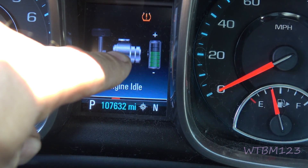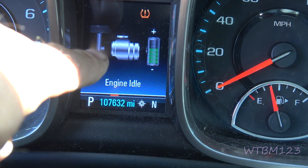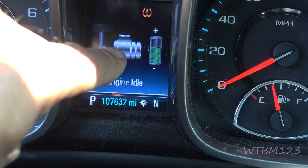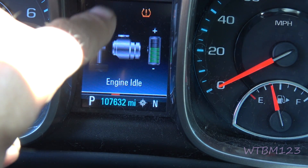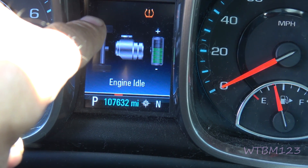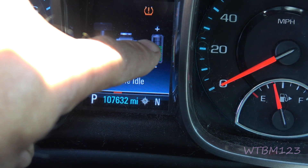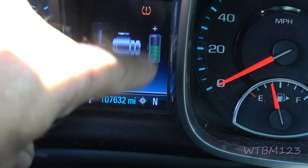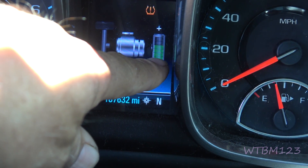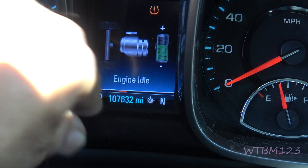Here's your little drive motor. These are the batteries back underneath the seat there by the trunk, and then this is the wheels. You'll see a green arrow when you're driving — it putting torque from the drive motor out to the front wheels. And then when you slow down, you'll see the green come from here with arrows going into the drive motor, and then you'll see the battery charging. His problem was the battery was down at the bottom and it never took a charge.